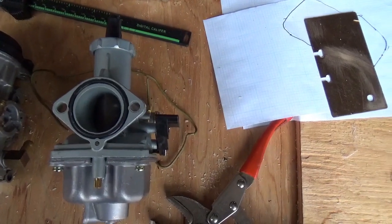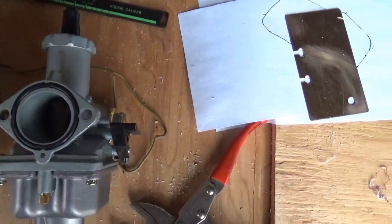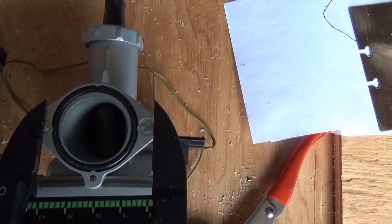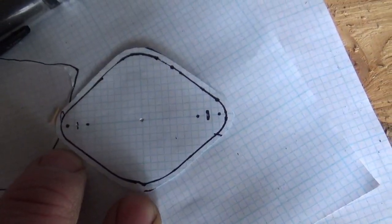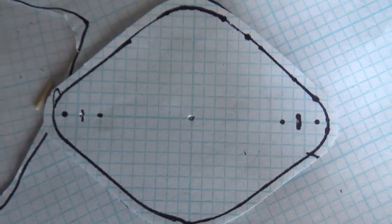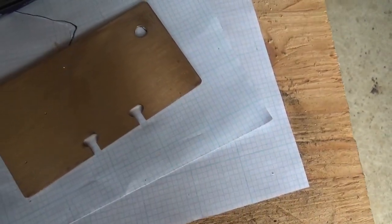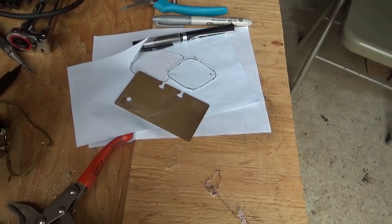As you're trying to mount this, you're really just trying to figure out the center of three holes to drill, and then you just cut out around it. I use these and I went all the way to the outer of those and then the inner of those two, and you mark that right on a piece of paper. You can see the outer markings and the inner markings — this hole is just the center. When you put it on graph paper you start counting squares and everything falls right in. Then you get your punch and a piece of brass — ding ding ding — and from there you just start drilling and cutting.